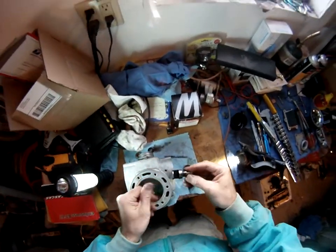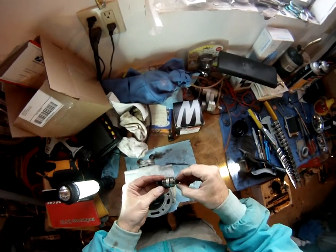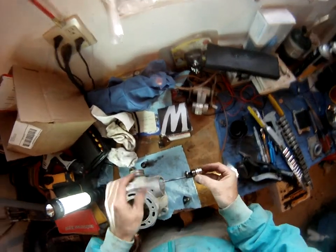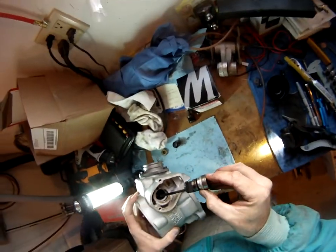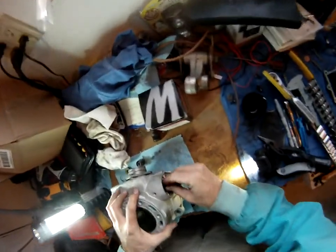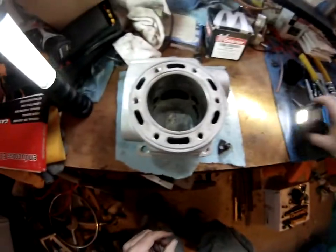This is the right side power valve assembly and it's got a little spacer here. Bearing goes on - I soaked these bearings for three or four days in two-stroke oil so they should be pretty happy. A little collar goes on the outside. And then the rod, we can go ahead and put in and slide this in on this side. We want to make sure we index the power valve flapper right down the slot, and we'll check that before we go any further. This will just slide in. The collar's just gonna fall right off there. Seated. And now the power valve doesn't go up higher or down too low - that rod's going right through the middle of it and it's holding in place.